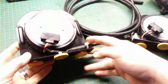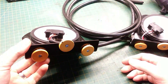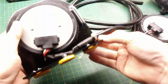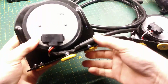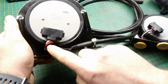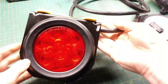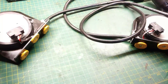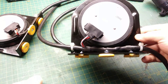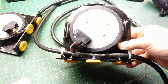I have everything assembled and this is actually a complete unit now — it works really well. I've had it on top of a car and tested how strong these magnets are, and I'm really pleased. I drilled holes in the front of the brackets to hold the cable so that you're not pulling on the plug when you tug on the cable. Just a couple of holes and a good quality zip tie keeps the wires protected from being pulled out of the plug. From the back right light straight on through, I did my typical soldering and heat shrink tubing, and it also has a cable tie on each side so that when you pull on the cable, you're not pulling on the plug.